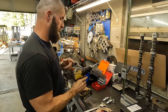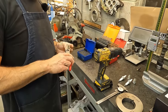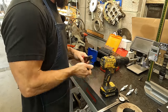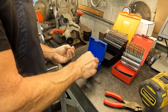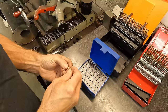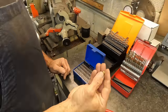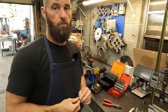So I got a 50/1000ths, which is a number 55 drill bit. We'll gauge pin it just to see where it is, because it's probably a little oversized, but we'll check it. Yep, a 52 won't go in, but a 51 will go. So we're gonna try that, and Andrew will go make a pass, and we'll see what happens. Stay tuned.